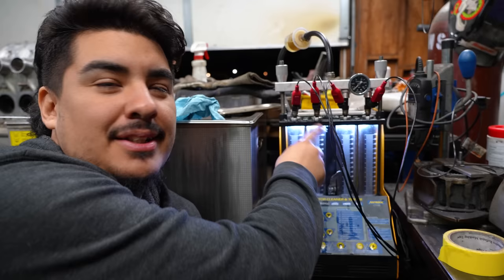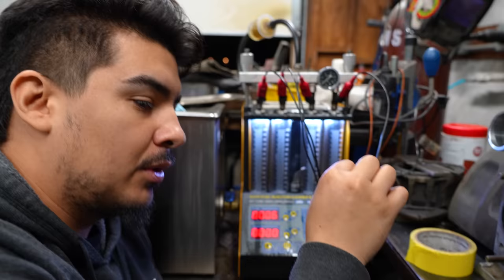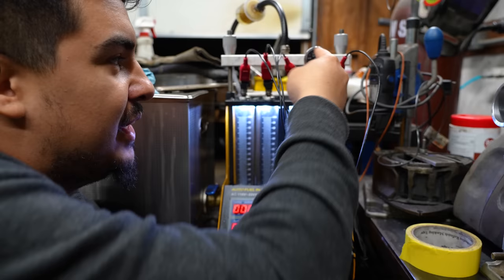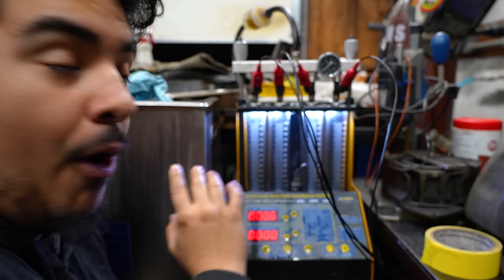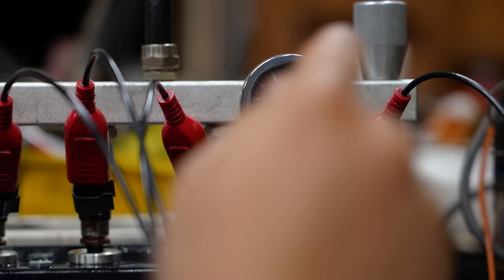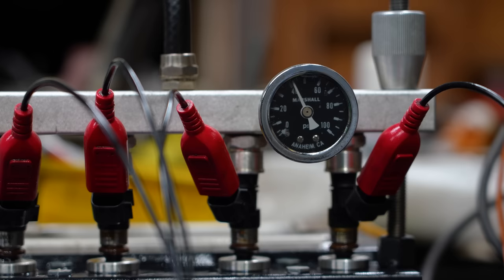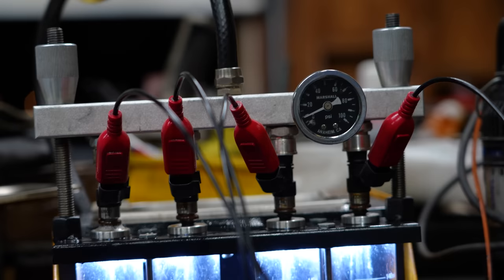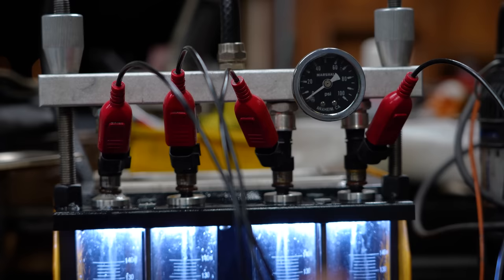Right now I'm doing a shift speed test, so it gives you lower and higher, pretty much like you're pressing the throttle, so it's demanding more and more fuel. What's happening is, we see it starts off at a good PSI because it's not opening as much, then it opens up more, then it opens up more, and the PSI just drops to zero all the way at the end because it's using all the fuel that this little pump could produce. So we see the PSI, okay, that's normal, it's like idle pretty much. That's like high speed. That's all the fuel that this little pump could pump.